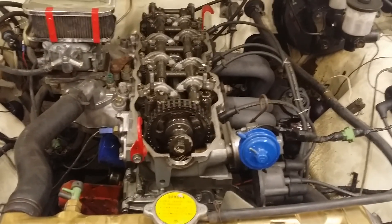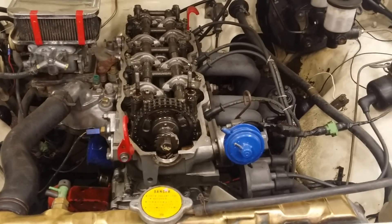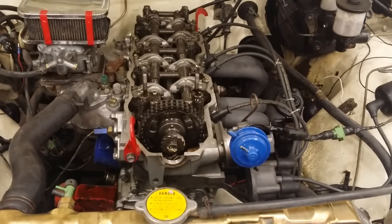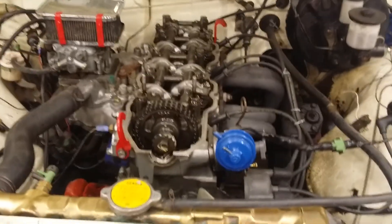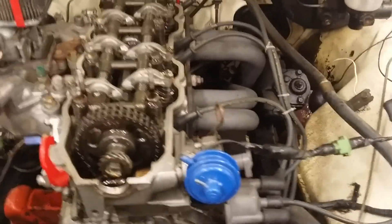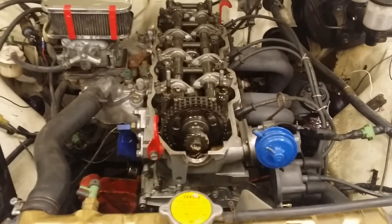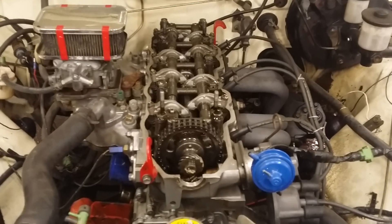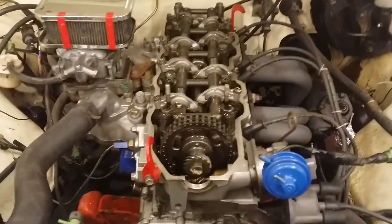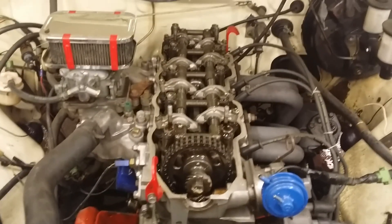It came out of a four-wheel drive, so I had to swap the pickup tube and the oil pan off the other motor over. I didn't do that at first — I forgot about it, and I started to set it down in there when I realized the tie rod that ties the steering from one side to the other was actually going to hit the pan. So I had to switch that around. I got it in one day, and then the next day I just buttoned it all up, got it running, and the thing runs awesome.